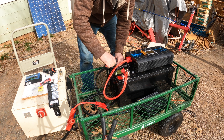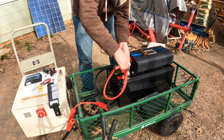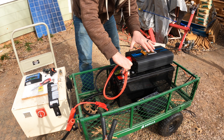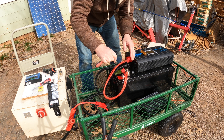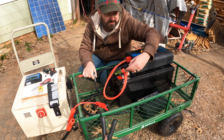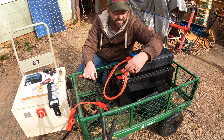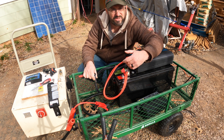Now I'm going to tighten and torque them down so they're tight. Don't over tighten these things — people have a tendency to over torque. All of these things, including the battery, have torque specifications — follow them. If connections are too loose, they can spark, short, and create heat. But if you over torque things you can break components. Just follow the manufacturer's recommendation on torquing.